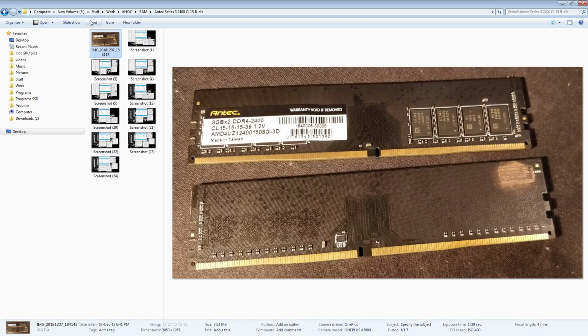And actually for this video especially, I'd love to hear suggestions and any kind of questions, because as I've said, I suck at RAM overclocking. I don't know how to review RAM, and I'm trying to figure out some way of doing that. And this is currently the idea I like, because it's quick and dirty right now. I'm not mem testing anything. I'm not going for bulletproof stability, but it's just like, okay, it passes Geekbench, and I'm not running MaxMem or anything. I'm not doing any of the stuff I do for extreme overclocking where we shove like 2 volts into the sticks. It's just 1.5 volts, or whatever voltage the kit itself maxes out at, because there are Micron ICs that'll stop at like 1.35 volts, or 1.32 or something like that.